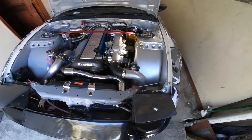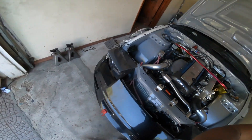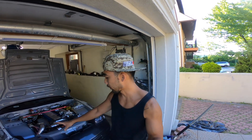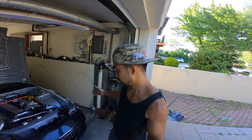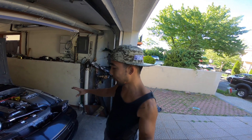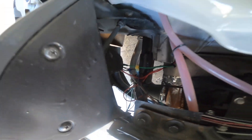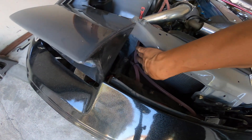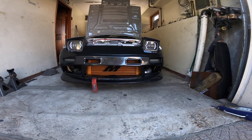Let me tell you what happened with the headlights. I parked the car for about a week, turned the headlights on, cranked it up, car was running fine, and five minutes later both headlights went off. I think a wire got cut somewhere during installation. So I had to get new headlights and rewire pretty much everything. I also had to cut out the headlight motors because they wouldn't fit the new radiator — it was a pain but totally worth it.